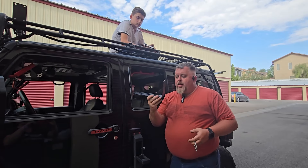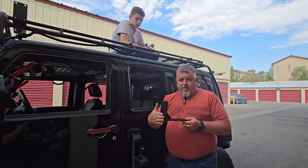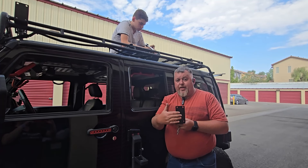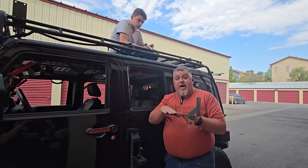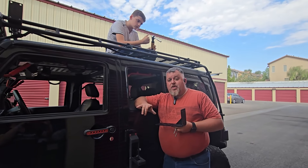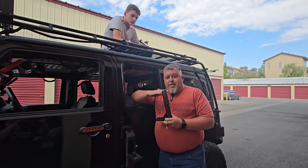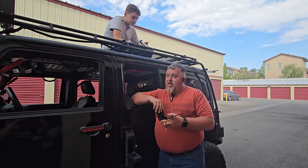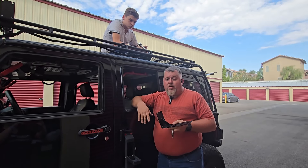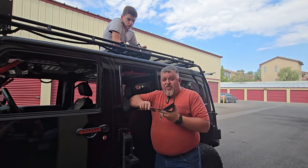The brackets they give you from Open Road have a long side and a short side. By rights, this side is actually supposed to be the side that holds on to the awning, and this side therefore mounts to your rack. It is fully possible to use it the other way if you're trying to meet a height requirement. Open Road says the awning itself should fall somewhere around 78 inches off the ground for optimal efficiency, and in my case this works perfect exactly as recommended.